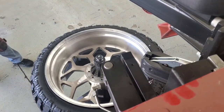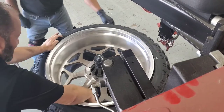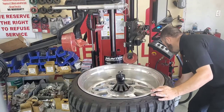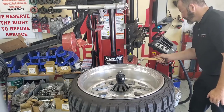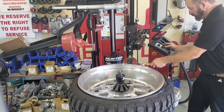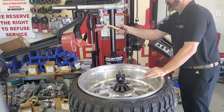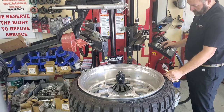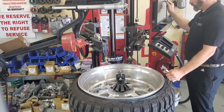Go ahead and clear your tools. Once we clear all the tools we can inflate that to the pressure we need. There's me searching for the valve stem — it's kind of hard to see on the back side of the wheel, but rotating around until I found it. So here's the next tire. You'll see I'm lubing that bottom bead roller just as I break that bead. I have my hand underneath just confirming the bottom bead is broken. Then I'm doing the upper bead — same thing, putting a little lube on that roller so it feeds itself down in there, indenting it into the wheel and pushing down on the bead bundle until I open up the gap. From here you'll see the steps a little better because we're looking at the front of the machine, and I'm going to go ahead and lube that hook so it can feed down into the tire a little easier.